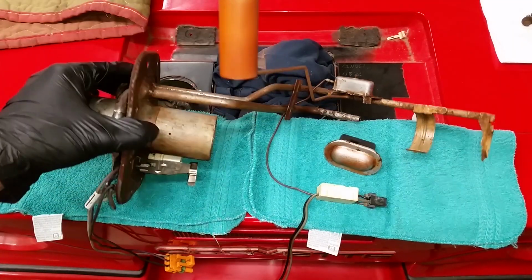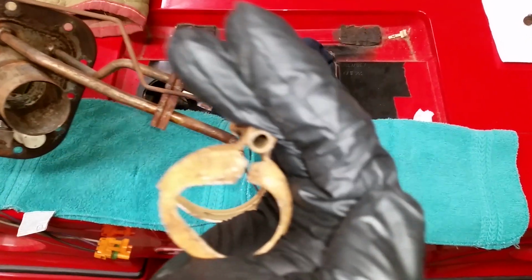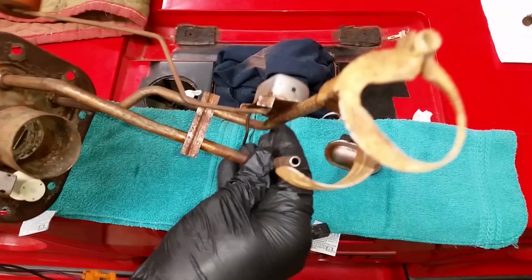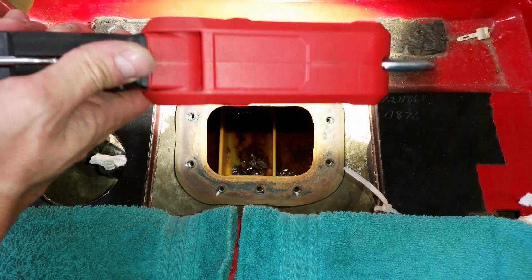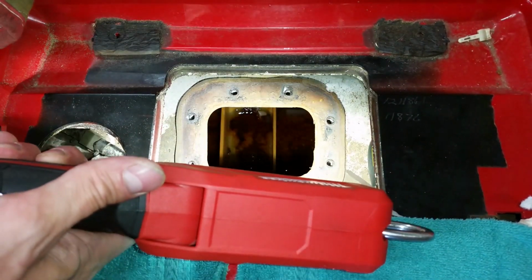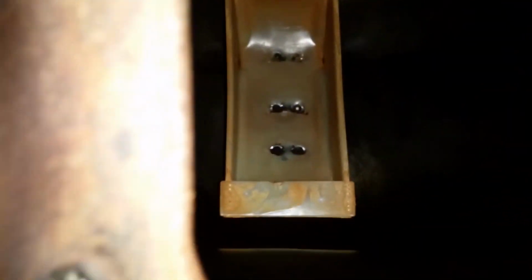It actually looks a lot better. This is the return tube. It was so badly blocked that I had to use a drill bit to clean it out. I flushed all the tubes with carb cleaner and they seemed to be flowing freely. I used one of those cheap $7 manual fluid pumps to pump over 4 gallons out of the tank, and it worked great. Then I just reached in and cleaned up the rest by hand. I was really dreading this task, but it wasn't that bad, and it turned out well.